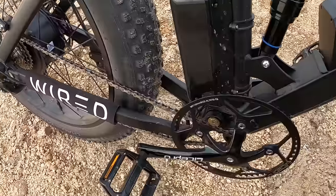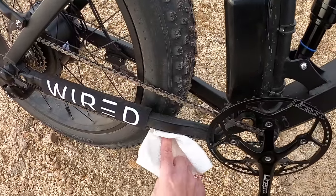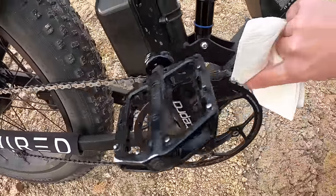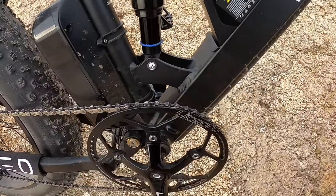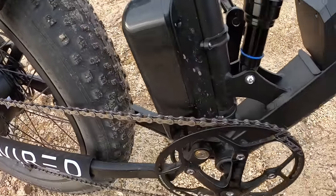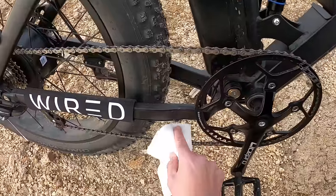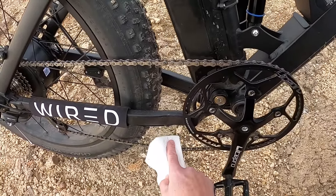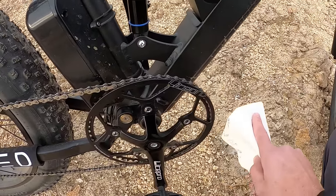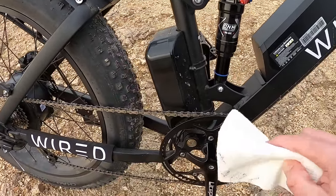You're going to have to get this chain back on. The easiest way I've found to do it is — unfortunately I usually use my finger — if you put your finger underneath here, it will extend that arm enough to where you can put it back on the guide, roll it around, and then let it go. That will put it back in place. If you try to lift it from the top and get it back on by lifting it up here, you can't turn this because your tire is touching. So if your chain comes off your front chain ring, push down from the bottom right here — you'll get one finger greasy — but lift it around and that will bring it back on the guide. You can go backwards with no problems; your bike won't go anywhere.